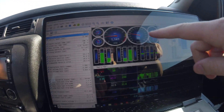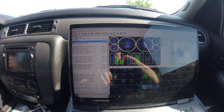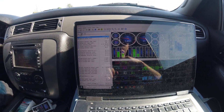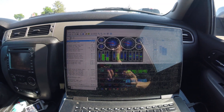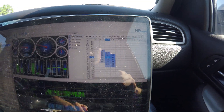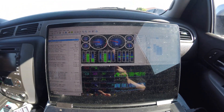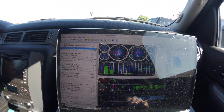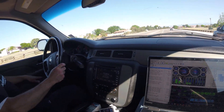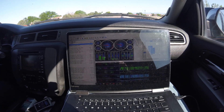You want to watch all your trims from the O2 sensors and make sure all your sensors are reading right — engine coolant, speed, and so on. Something else we'll probably adjust is the speedometer. This is the latest version of HP Tuners — updated it last night. Looks like it worked — it turned off the active fuel management, so he should be happy with it now.